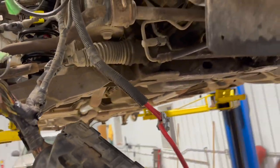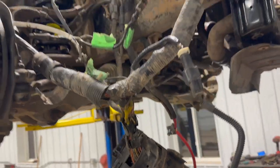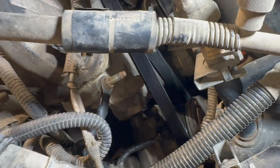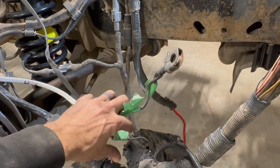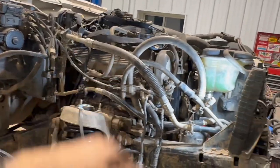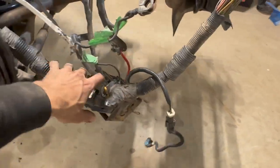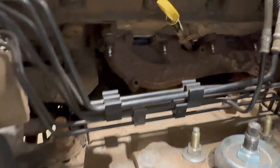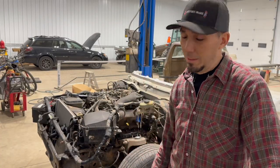I'm going to get some actual copper eyelets for the ends of my battery cables because I really don't want corrosion forming there. Found a whole bunch of bad wires in there that I'll tape up and get sorted. Also discovered that my main engine ground was barely hanging on by a few strands — glad I found that. I've been marking all my grounds with green tape throughout the build. Some of these grounds are temporary just until we get more body work on, but I want to make sure the car starts and runs fine. New serpentine belt is on too.